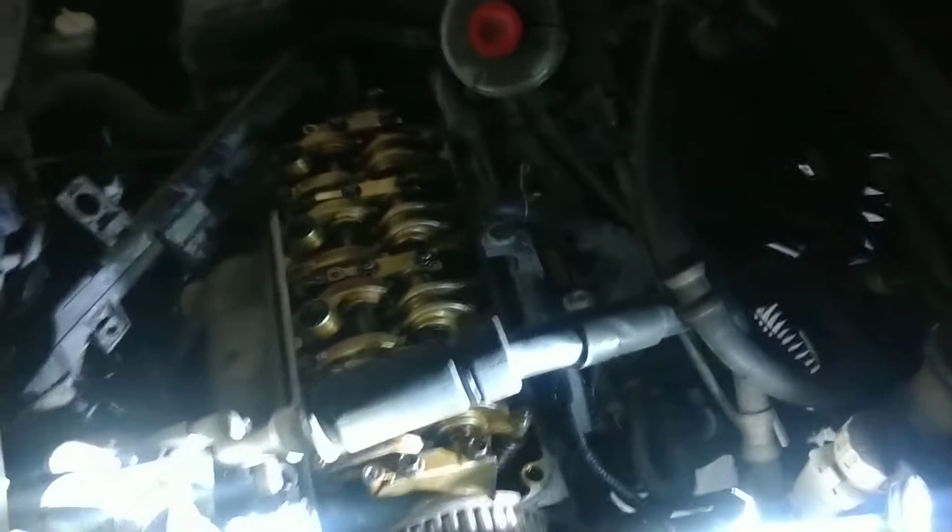And then before that, you need to undo the power steering pump, I guess. A little ahead of myself. Power steering pump is two 12mm bolts that hold it in at the top. Those will be pretty obvious to take out. Take out your reservoir, the red cap over here. Set those both aside. The hoses, let them just lay up on top of the engine. Make sure you're not spilling fluid.